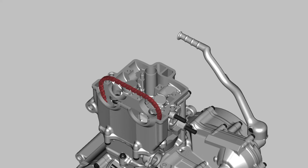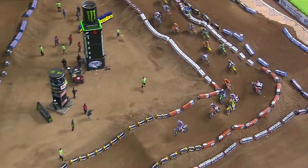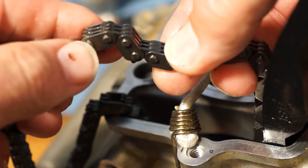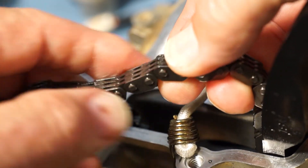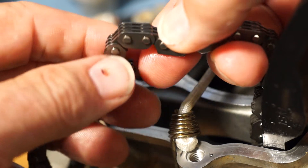The timing chains on modern high-performance bikes are under a great load, especially when racing. We recommend closely inspecting the timing chain on the YZ250F and 450F every time you're checking the valve clearance. Pull up and support the chain so it doesn't bind on the crankshaft drive gear as you rotate the engine all the way around. Inspect each section of the chain, making sure each group of plates pivot freely and do not have excessive free play.